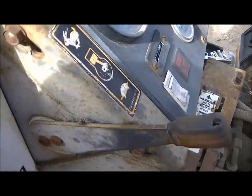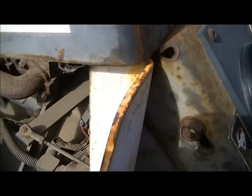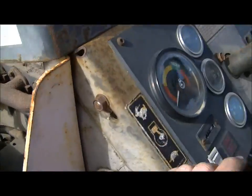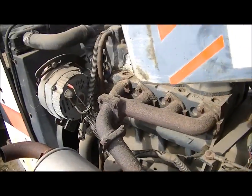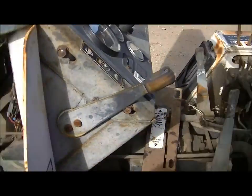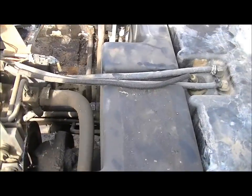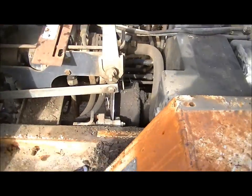Got full fuel. The throttle needs some lubrication — it's squeaking pretty bad. I'm going to go through it and make sure everything's okay, take off this hose that is still dripping, and fix that o-ring. Then we'll be good to use it.